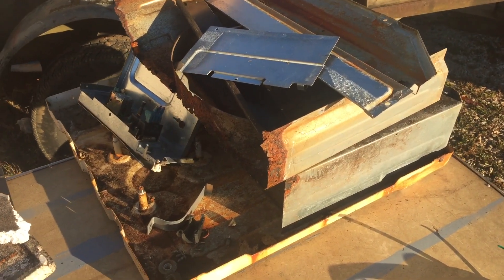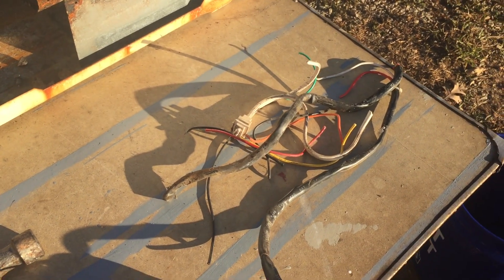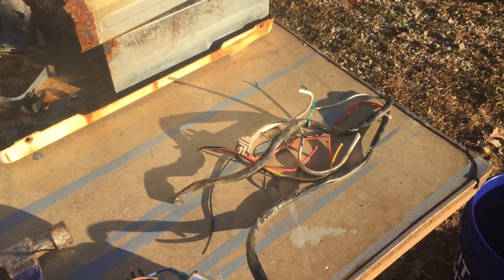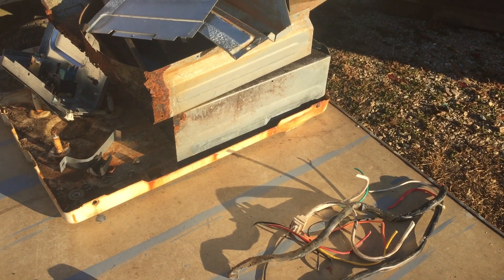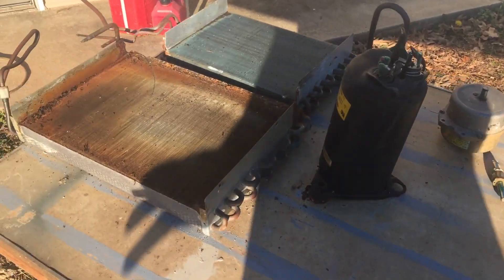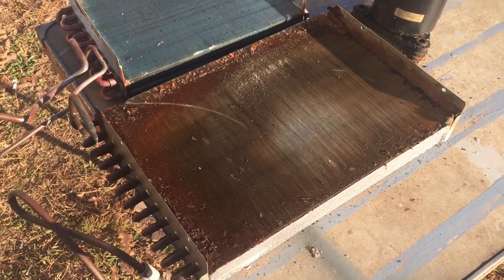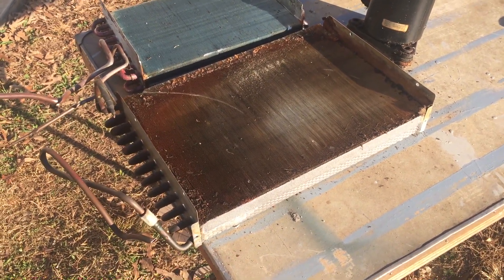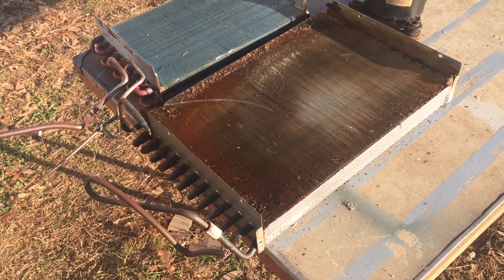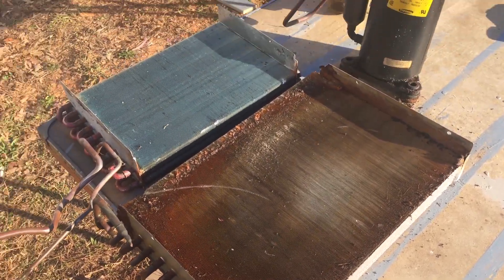There's your shred from what you were pulling off the outside. There is the wire minus the cord — it will have different lengths of cord and you can cut the plug off however you want to use that. The first stage would be just taking the whole thing to the scrapyard and getting shred price. This would be like the mid-stage. You can take these coils — radiators, whatever you want to call them — this way and that will pay you a certain price, irony. Or you can cut these coil pieces here off the side smooth, either with a hacksaw or a cutoff wheel, and take that metal off and then you'll get a much better price.